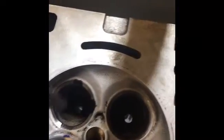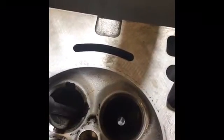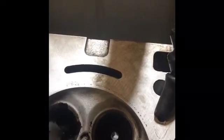And once again, we'll show you how to set this up. So we're going to put our shaft inside of our guide. And push it down there. It's taper fit, so a little tap on top will make sure that it's nice and flush in there so that we have no play. What you're seeing is the entire head move, but this shaft is actually nice and solid inside of our head.